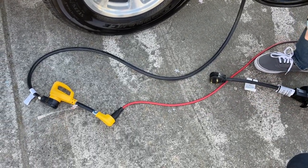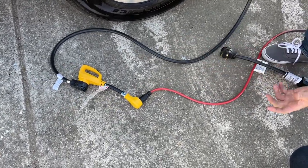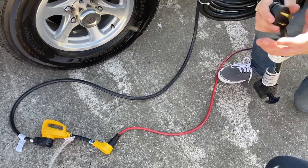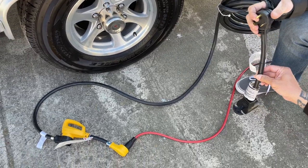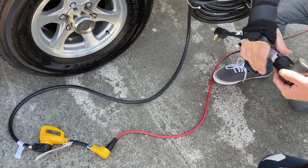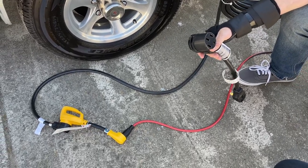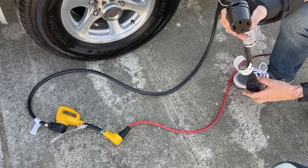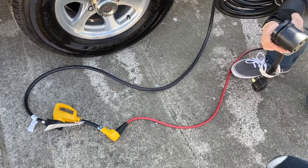You'll also want to get adapters — like this 15-amp one — for when you're at home or for emergencies if you only have a 15-amp outlet. This here is 15-amp, yours is 30-amp. The bigger trailers are 50-amp and have larger prongs. Sometimes campsite boxes only have 50-amp options, so you'd want a 50-male to 30-female adapter to plug in. But most parks do have both 30 and 50.